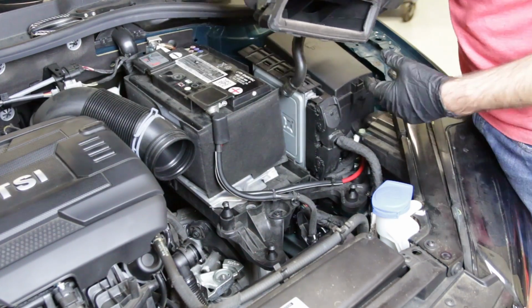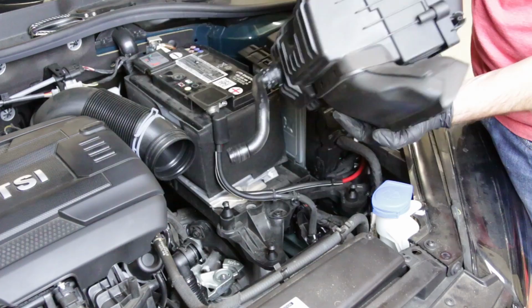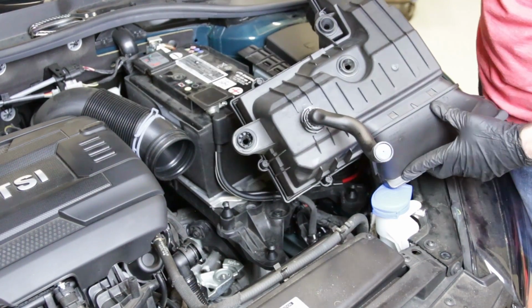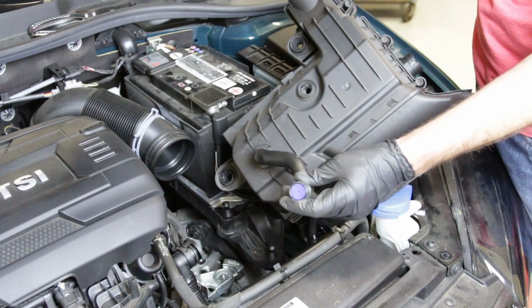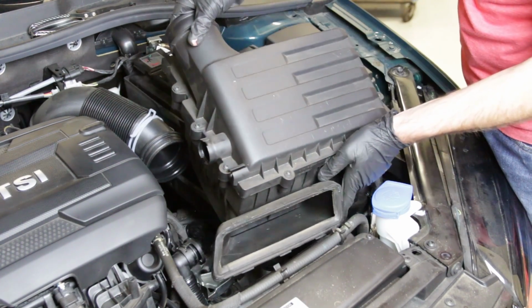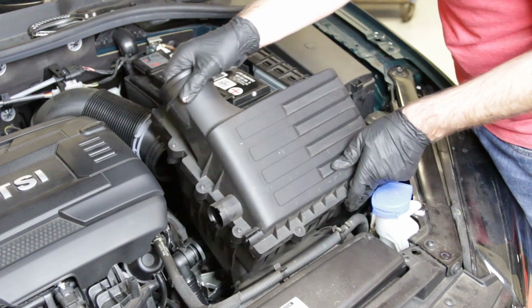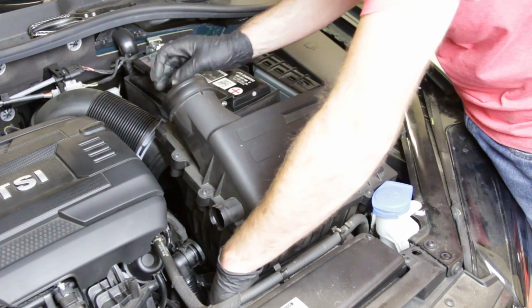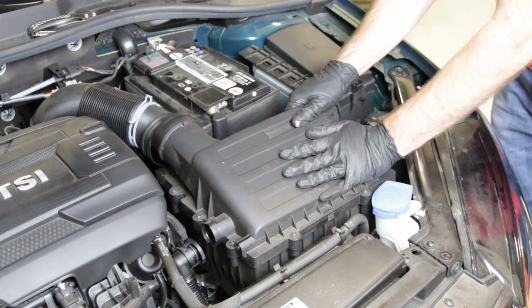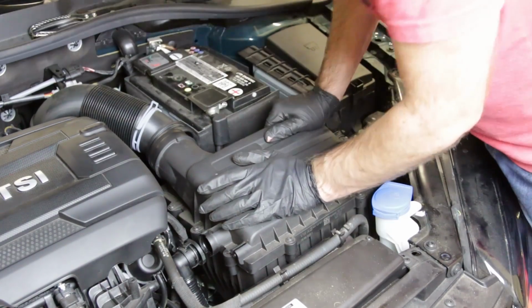All right, now we're going to install our cover here, and this is going to mount right on these rubber grommets right here, here, and here, which we showed coming off of. You will want to make sure that this hose is kind of clear as you go on. Go down like so, hook it up and in to the radiator support here. That's really where we're looking to make sure we go for. Clear that. Line it up with your grommets, and then pop it down in place.